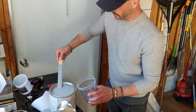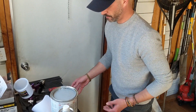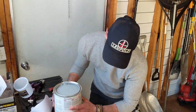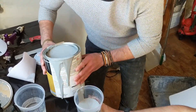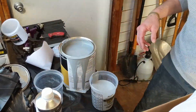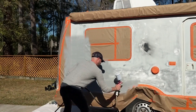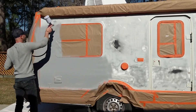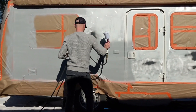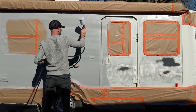So what do you do on thinning it? I have to mix it up first, and then I have to thin it out. Now this is going to be a test. You have to scuff sand all of the primer with 320 before final paint — that makes the primer stage a little more forgiving — so we sprayed both sides out in the open on this day.